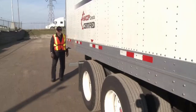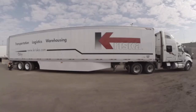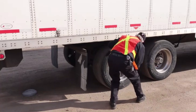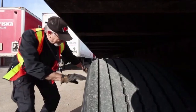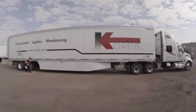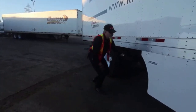Now let's move to the other side of the trailer. Same thing here — start at the top, working your way down. You're making sure there's no damage on the sides, that there are no shaved off rivets. You're checking the mud flaps, tire pressure, tread, rims, lug nuts, wheel bearings, and the capped valve stem. Getting down, make sure that the railings are secure and the pins are in place. From this angle, checking the suspension bags — make sure they're up, no breaks or damage or loose parts, and that the tattletails indicate the slack adjusters are in good measure.